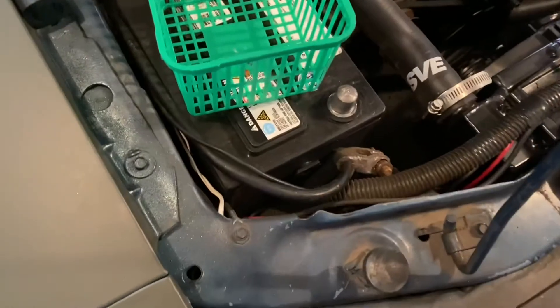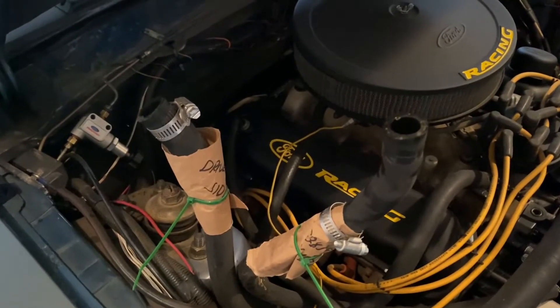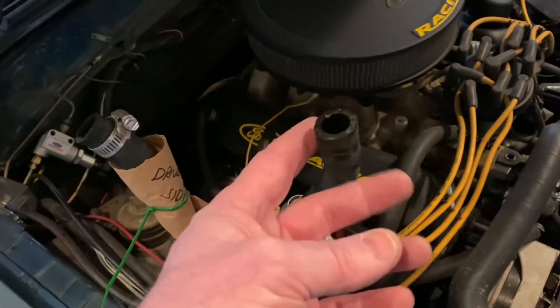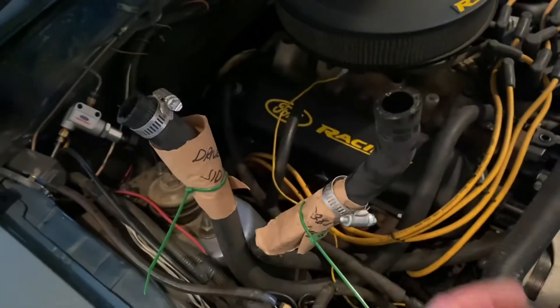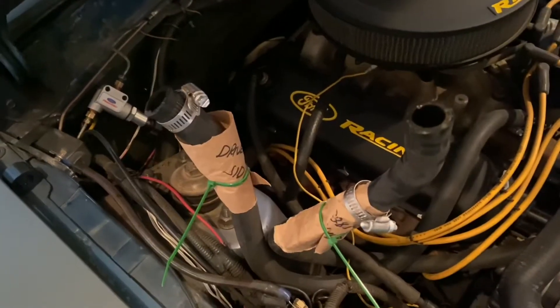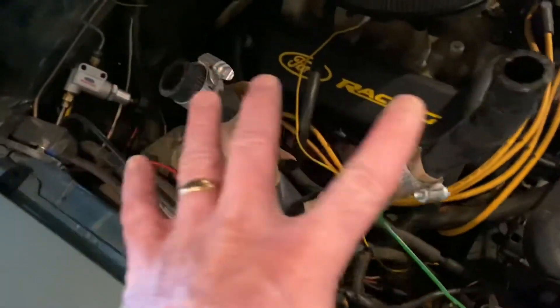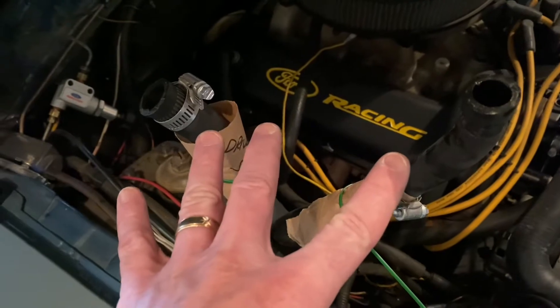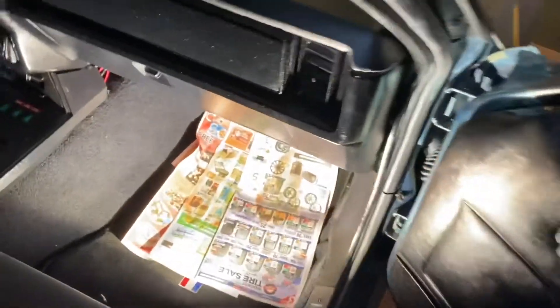I already started off here — I removed the battery connection since I'd be doing some electrical work. I removed the two hoses in the engine compartment; they came off easy since I replaced them a couple years ago. If yours are stuck, use pump pliers and give them a good twist to pop them off. I put a pan underneath to catch the draining fluids, and I put labels on the hoses so I know which is the driver side and passenger side for reassembly. I also had to disconnect the battery because I have green LED strip lighting under the dash.